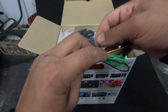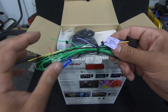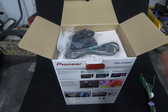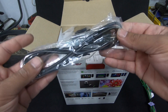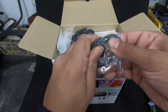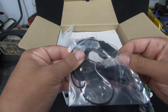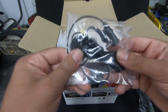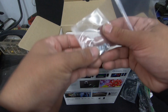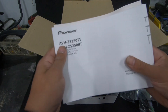There's also a reverse input wire. If you connect this wire to the 12 volts at the reverse light, you can put the car in reverse and it will switch the head unit to show the image at the back of the car. There's also a rear-mounted USB - plug that in and run the female end to the glove box or wherever you like in the car. You get an external microphone, which is a great feature to have. Also included are mounting screws and the instruction manual.